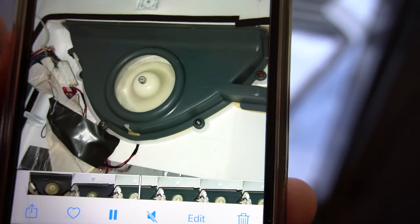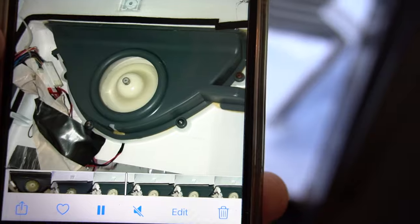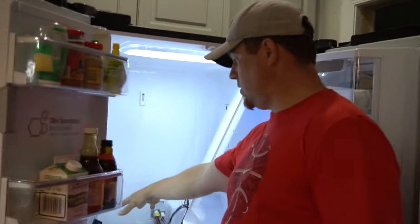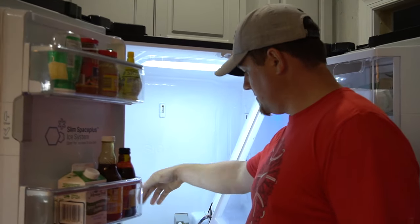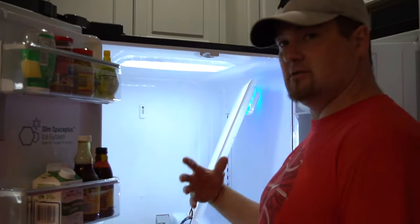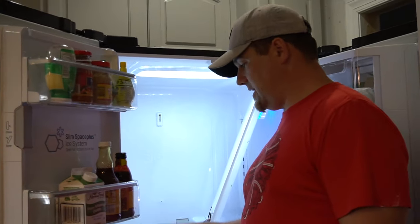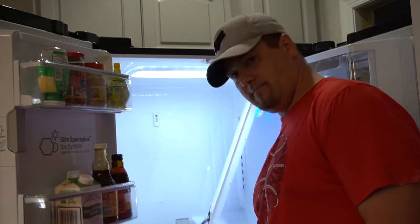Let's review the footage — about 23 seconds after closing the door it turned on, so we are good to go. Obviously if your compressor is still good, it is sending cold air through these coils, and then the fan is blowing into the fridge which cools your food. One thing that may tip you off: if you ever have condensation or water droplets anywhere in your fridge, that shouldn't be there — the fridge takes moisture out of the air, so that's a sign something's wrong.